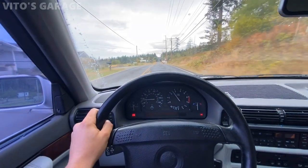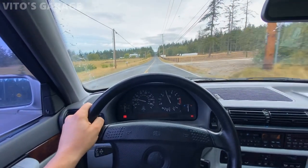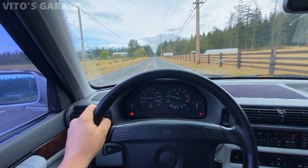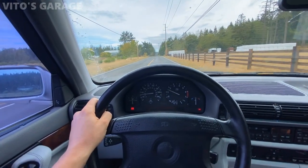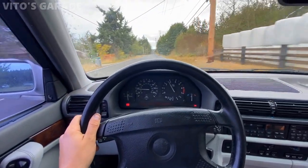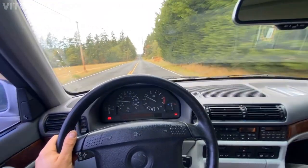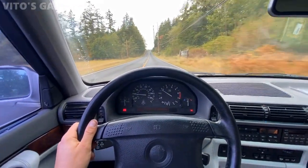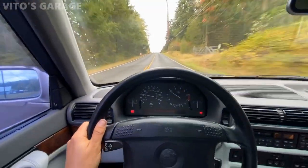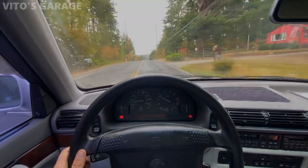Yeah, so it has a shake because of the tires, seems like. Those tires probably in the back, they're not balanced. So it has a shake around 50 miles an hour. It's all because of the tires. So either way, Mitchell, you will have to put better tires on that car. Or newer ones, you know what I mean? Because you see what it's doing. Yeah, bad tires, actually.